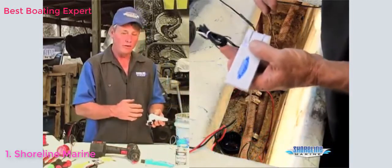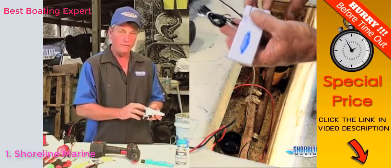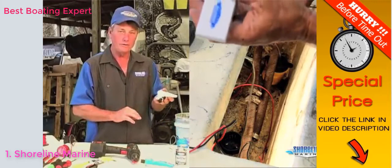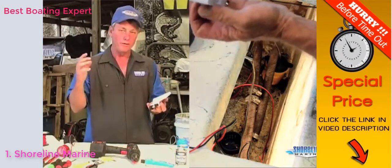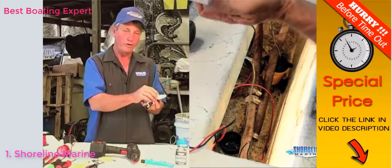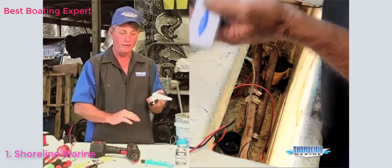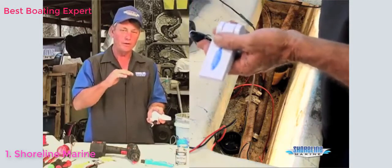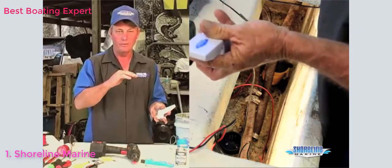Okay, we're ready to install our float switch. We want to find a location in the bilge where the float switch is higher than the bilge pump, or at least level with it. That allows, as the bilge pump is pumping out the water, your float switch to start lowering. When it shuts off, your bilge pump is still in water and not pumping air. If you reverse it, your bilge pump is going to be pumping air, your float switch will still have it on, and you run a chance of burning your bilge pump up.